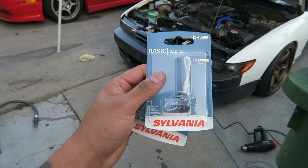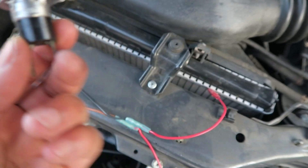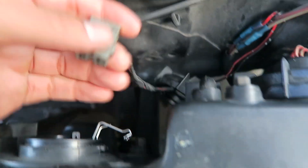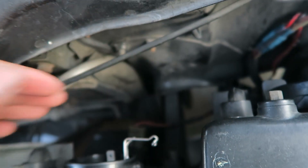I had to run to the store and buy these H3 bulbs because the bulb that was here was H10 — it's actually brighter than my low beam and high beam. So I got some fog light bulbs to put in there. I just realized now after buying them that the original plug is going to be pretty obsolete, because the H3 bulbs I'm using are going to be plugged in with one of these connectors and another one. I might just leave the old plug hanging, but I'll plug it in and see what happens.